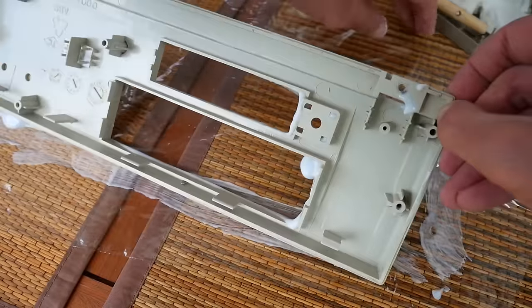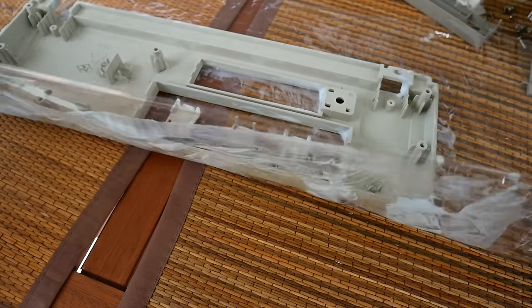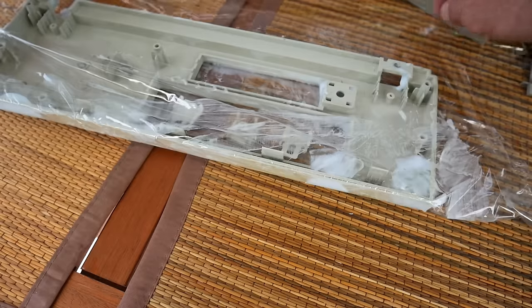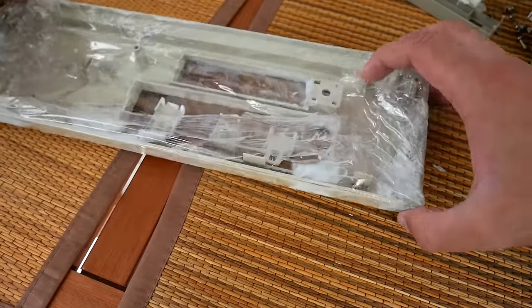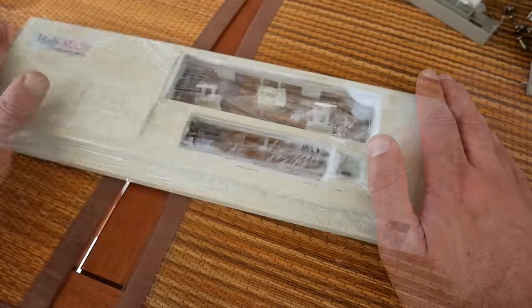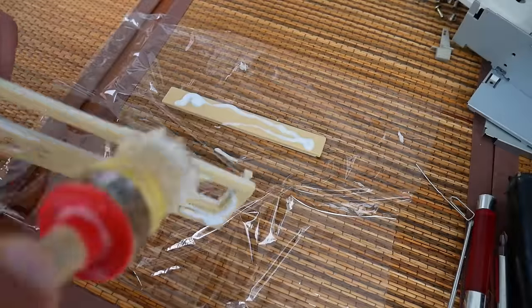After applying the peroxide evenly, the whole part has to be wrapped into a transparent foil, and then the gel inside should be once again massaged for even distribution. It is very important, otherwise the brightening will be uneven, resulting in so-called marbling effects, with the yellow smears all over the place.